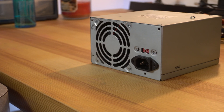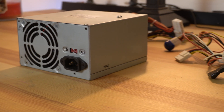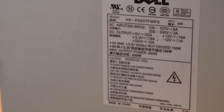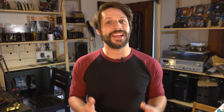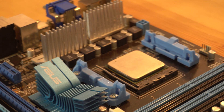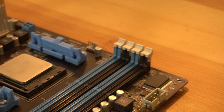I have this 250-watt Dell OEM power supply that I pulled from a very old pre-built. Now, Dell does have a pretty good reputation with their power supplies. However, this one's only rated for 250 watts, and we are going to greatly exceed that today. The CPU we're going to be running is an FX8320. The motherboard's going to struggle a little bit on its own just to supply power for that CPU, but it's still going to be a good test for us as far as our processor goes.